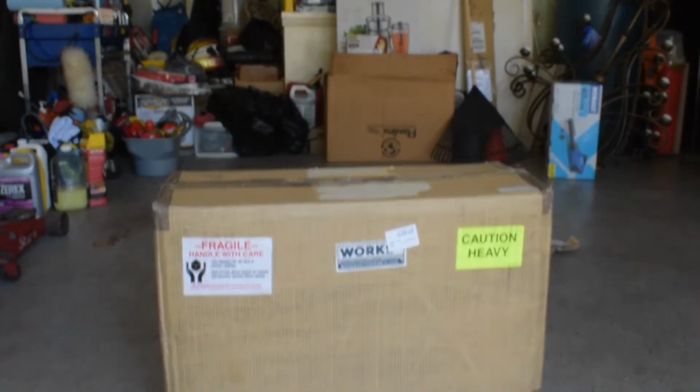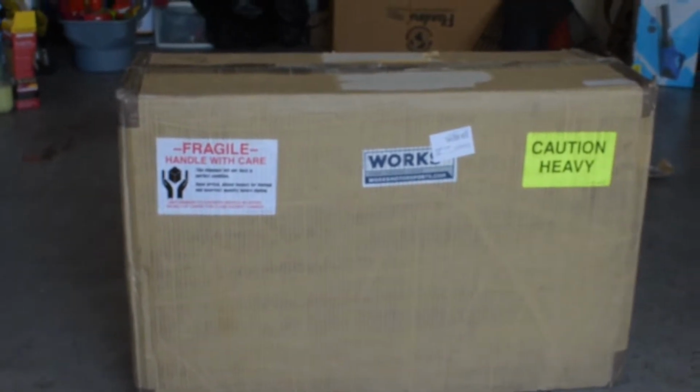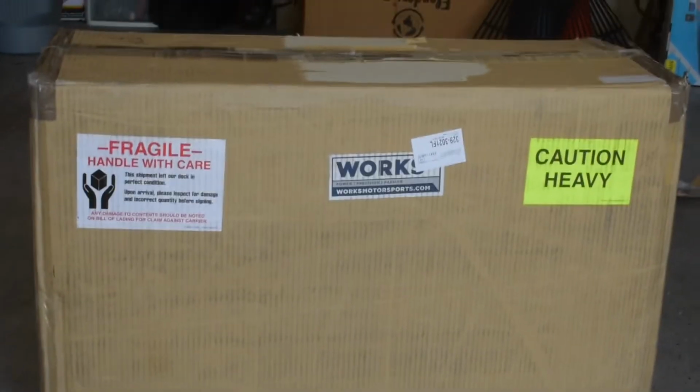Today I'll be showing you an unboxing video of the Ohlins Stage 3 coilovers. So I just ordered these off of Works. Works sells a variation of the Ohlins Stage 3 Road and Track coilovers. The stock ones, or the normal Ohlins I should say, are 10K spring rate for up front and 7K in the rear. With the ones through Works, you get 9K all around.